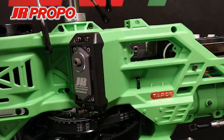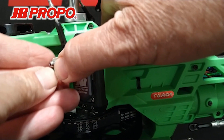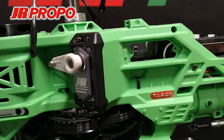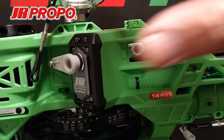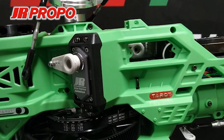With the collective stick at 50% and other stick functions centered, we're going to install our servo arms. In most helicopters we want the arms as close to perpendicular to the push rods they drive as possible. If you're using JR Sub-Trim Free Servo Arms, there's a clamp on the arm — with the servos in this position you can rotate the arm slightly and tighten the clamp. Don't forget to put a bit of thread lock on the bolt. With conventional plastic arms like we're using here, there's an additional step we'll address in the next video.